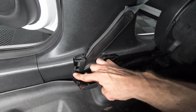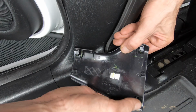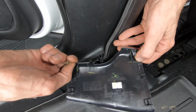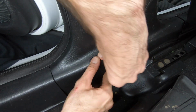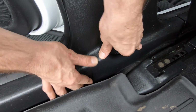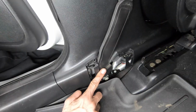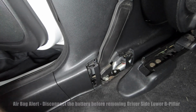You have to put these tabs on the left and on the right, insert them sideways, and then the tabs on the top need to go downward. 2 tabs on the right side, 1 tab on the left side, and then 2 tabs on the top to push down. That's on. It just won't push down into the top inserts because of the sound deadener. And that's how you remove the lower B pillar in a 3rd generation Honda Fit. Thank you for watching.